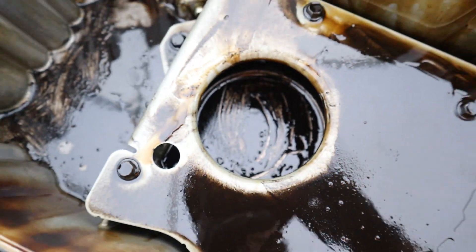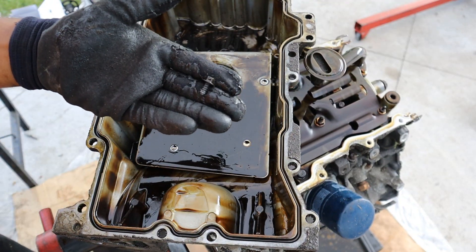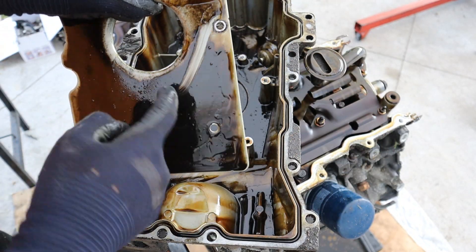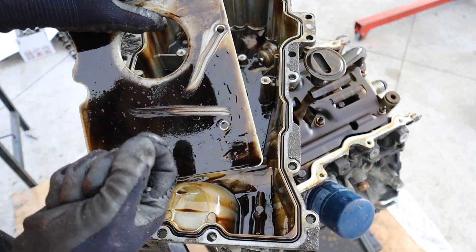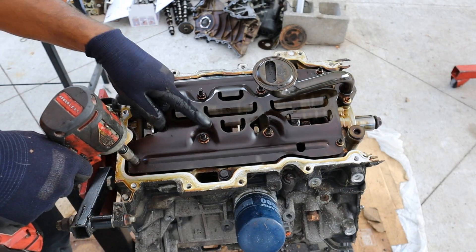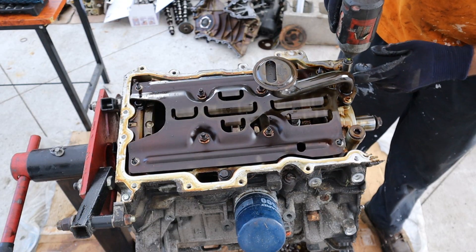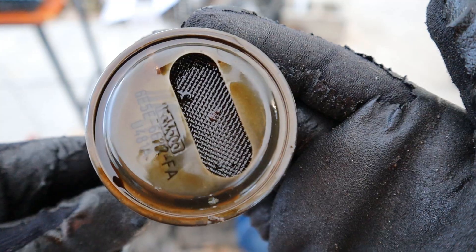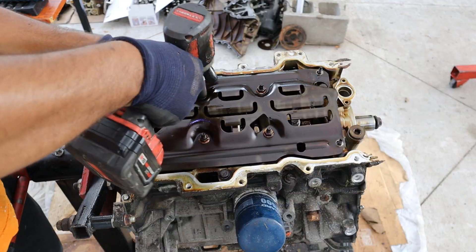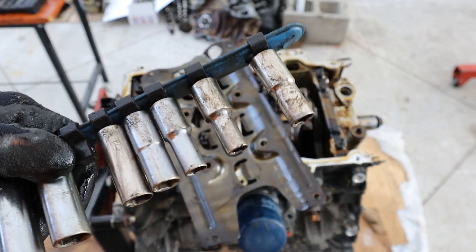Those chunks look more like sludge. They're using self-tapping coarse-threaded screws here — let's see what lies within. The bottom of that is pretty clean, which tells me the oil had a bit of sludge inside and was sitting over here. I'm going to remove the oil pickup tube, and here's a closer look at what's inside — looks like we do have a couple of chunks that got picked up in the screen. There's more of that paste on there.